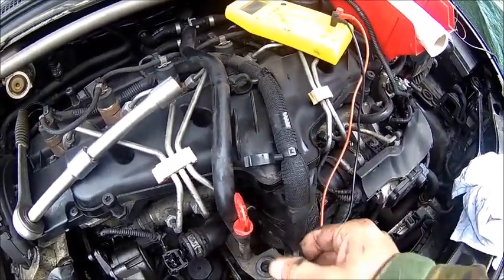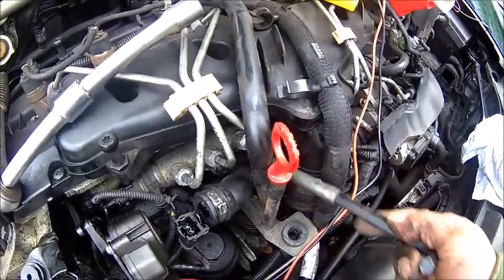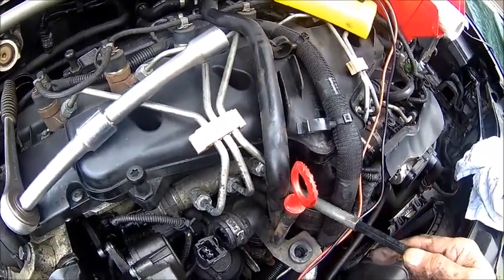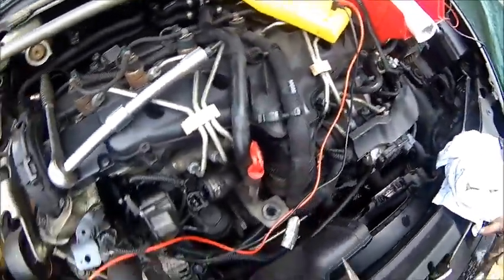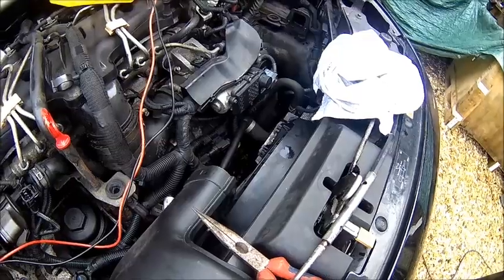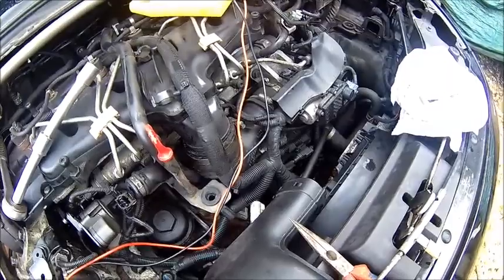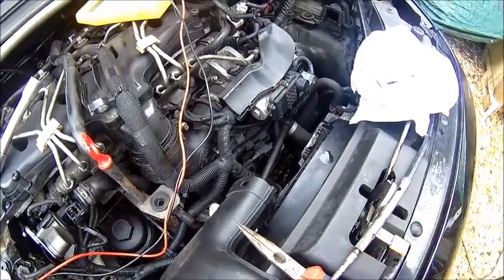If the others are too high resistance as well, I'll just swap them out. The little plastic sleeve which sits on the plug is actually broken — on both of them it was broken, so I'll probably need some new ones. And when you put them in, put some anti-seize on. It helps.